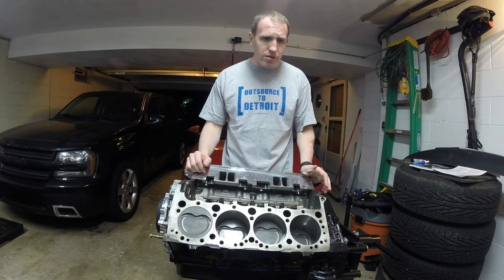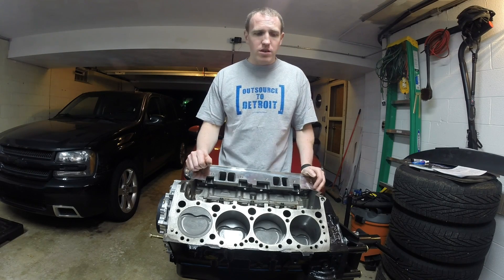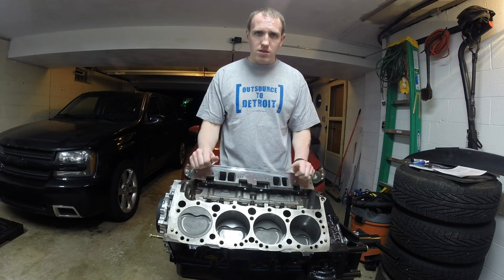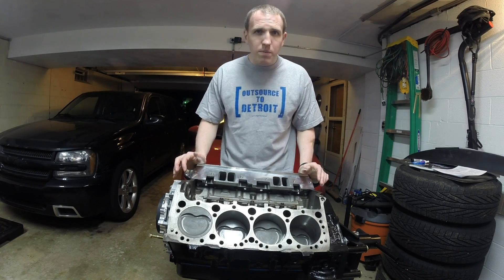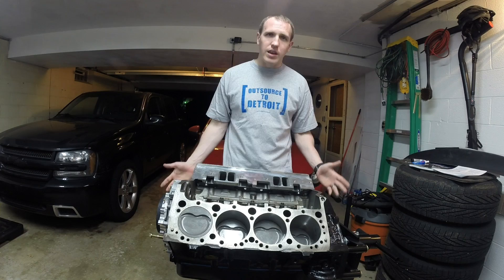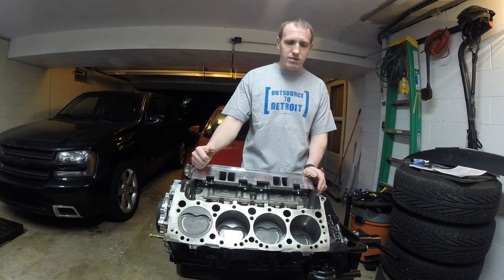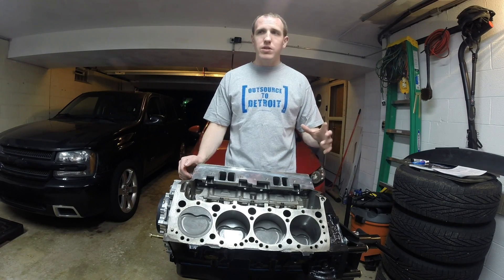What I'm going to do is walk through this and talk you through what I'm doing. If you disagree, that's cool — maybe leave a comment. This is the LT1 cylinder head walkthrough. I have a rotating engine stand here. I'm going to spin it so the driver's side bank of cylinders is flat on top. You want to keep things clean — try not to get water, oil, or antifreeze floating around in the garage. First step is to rotate, and then we'll start the install.